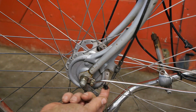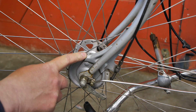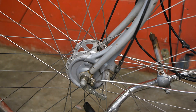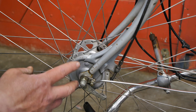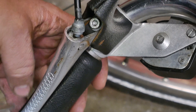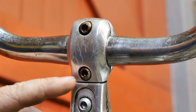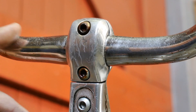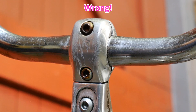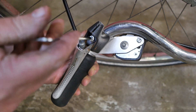I just loosened up this brake cable to gain access to the allen head bolt in the brake lever. I noticed there's a difference between the front hubs — this one says Sachs VT 5000 and the other one from the Ultra bicycle says Sachs Orbit VT. What's in the name — they look the same and should be swappable. While I was getting ready to take out the allen head bolt and remove this grip, which would be a terrible struggle, I just found out that the stem from the Pointer bicycle has two bolts, so I do not have to push the handlebar through the stem from the side.